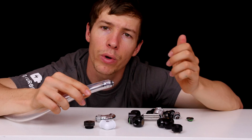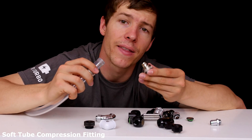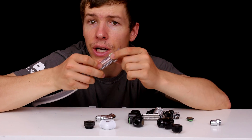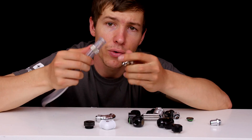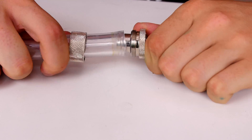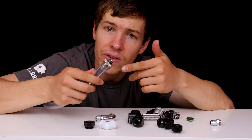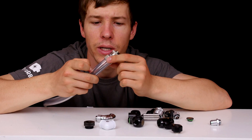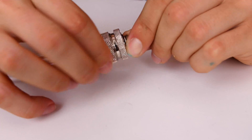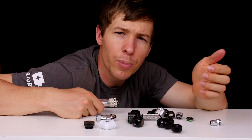However, barb fittings don't compete with compression fittings, which add a little more safety. Compressions work the same way but are compressed further by a compression ring. First, put the compression ring on the tube facing up so the threads can screw into the barb. The barb inserts into the tube all the way to the end — just like before — and then you bring the compression ring up and screw it down, compressing the tube against the metal barb. Once tight, it's not going anywhere.